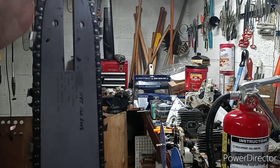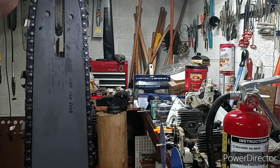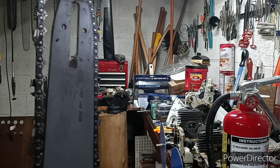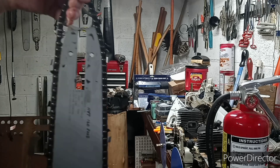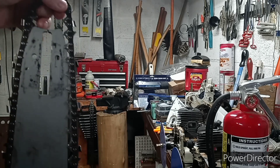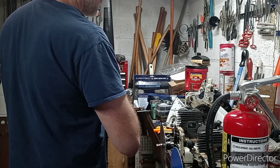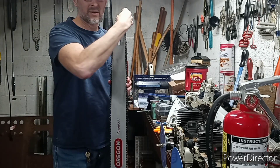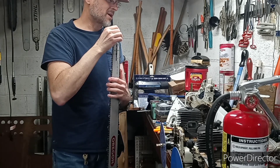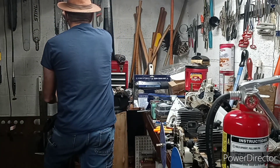I was asked to address a lot of misinformation, and we'll do it little by little. There are no $4 studs that allow you to run a steel bar on a Husqvarna saw. That's what Cannon Bar Works is in the business of doing — building a high-quality adapter that sits on the shoulder of the Husqvarna stud to run the 12.1 millimeter bar slots. Another thing I want to bring to point: that part number on that bar — nobody ever commented on that, nobody ever ran that part number. Commentary on the 400 video about smoking the clutch while running this 42-inch bar. I noticed that oil gallery right there — I read and see a lot about guys modifying those oil galleries. When you modify an oil gallery incorrectly, it's just like porting a saw incorrectly — you can ruin the flow on that bar. I had this on the 400 and the 562. The 562 has a 2017 oiler and the late model clutch, but it will oil that 42-inch bar with that setup. Run that part number for me.